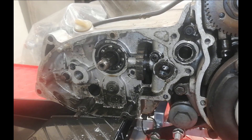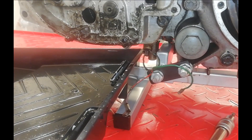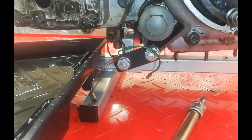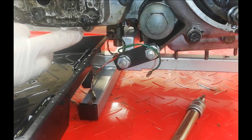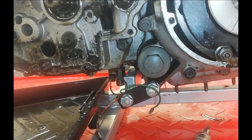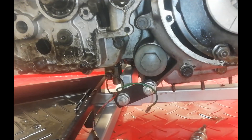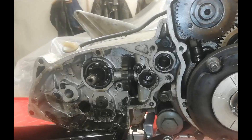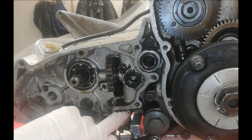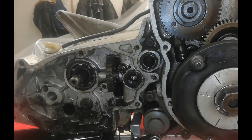Of course I've set the camera up perfectly so you can't see them. There's another allen key down there, and at the top there is a half-inch bolt — so you've got four bolts that hold the gearbox inner cover on: two standard allen bolts, one large allen bolt, and a half-inch bolt hidden under there, easy to miss. I'm going to remove those and then we'll be ready to take the inner casing off.